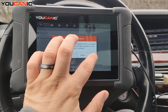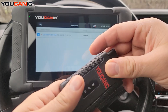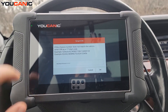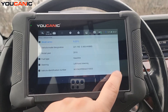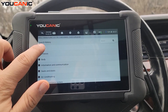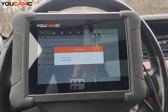I'm going to take the Bluetooth OBD adapter and plug it into the OBD2 port underneath the dashboard. Then you hit 'Smart VIN' to pick up the VIN number, select left-hand steering, and go to Control Modules, then Drive, then Engine Control Unit — in this case it's called Motor Electronics, and it's usually the first option on that list.